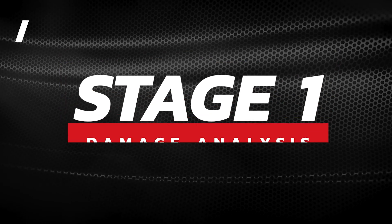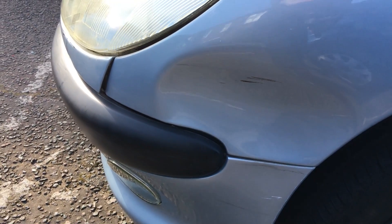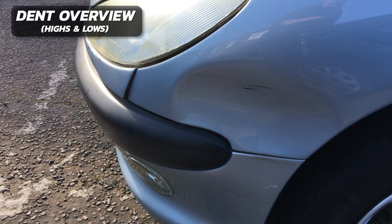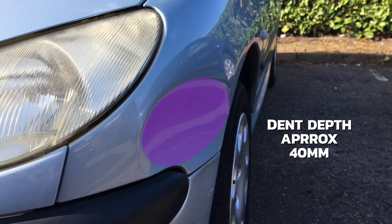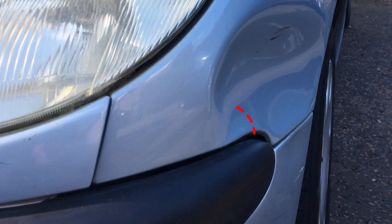Before I get started, let's take a quick look at both of these dents in detail. Looking at the left wing or fender first, we can see that the damage covers an area of approximately 300 millimetres by 200 millimetres. This damage really comprises one large bowl-shaped dent with a crown around its perimeter. The overall depth of this dent is approximately 40 millimetres. On the lower section of this panel we also have an edge that has kinked slightly.